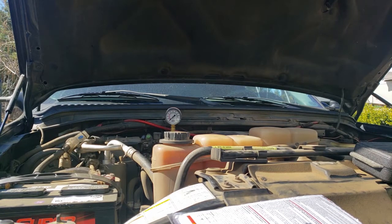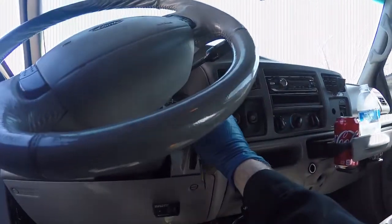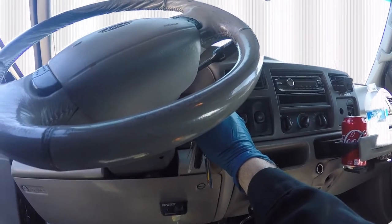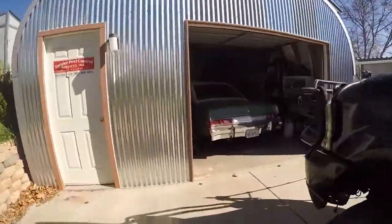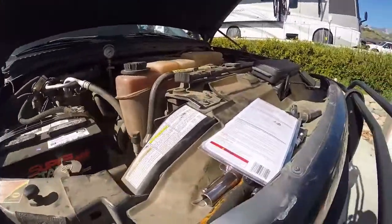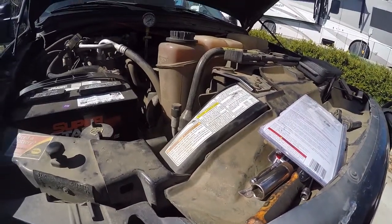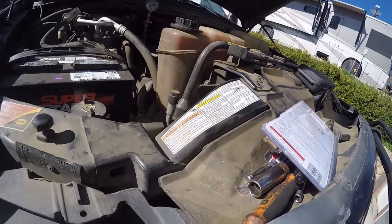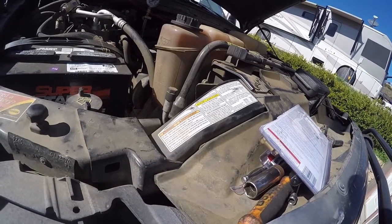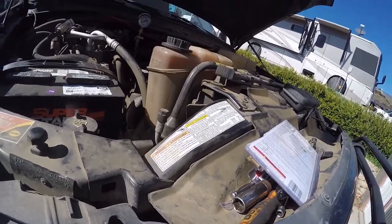So, let's take another look here. You can hear that differentiation in the engine. That means to tell me that yes, we are dead on compression. In fact, it's leaked down right now. It's leaked all the way back down to almost nothing. So yeah, that cylinder head's gonna have to come off. Which is not what I wanted to hear,